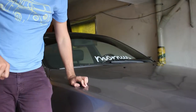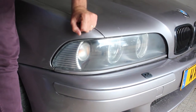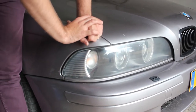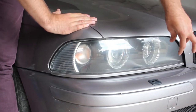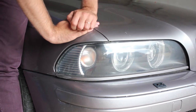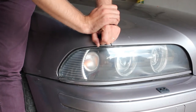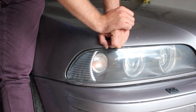I had three E36s before — they were all M50 models. I have a friend who has an M54 E39 and they sound a lot nicer. Regarding the headlights: we modified them to be quad projector, and I love the look — I'm really happy with the outcome. But with winter approaching and it getting darker sooner, if I'm out in the country and need my main dips, it would be nice to have them fully functioning. So I think I'll upgrade them to a bi-xenon standalone projector, which will improve the lighting output greatly.